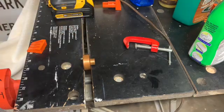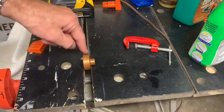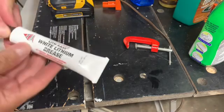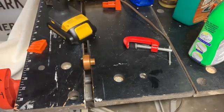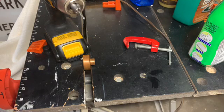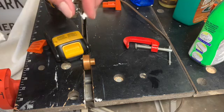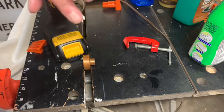The other concern when drilling into this is the metal filings that you're going to create — you don't want those going inside the rotor because they can damage the gears on the inside. To prevent that, that's what the lithium grease is for. Put a little bit of it on the end of the drill bit and any metal filings that are created are going to stick to the drill bit.